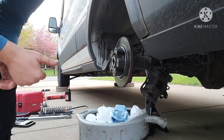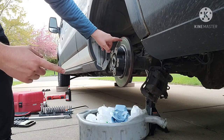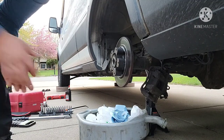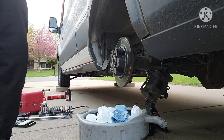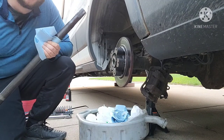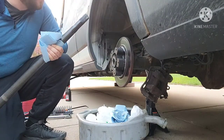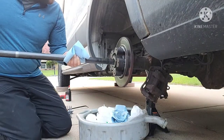All right, so the nuts are retorqued for the inside of the hub. Brake rotors on, cleaned up and anti-seized. Now we're gonna wipe off the shaft of the axle as we slide it in, and we'll throw the bolts in, torque it down. We're almost home free. All right, the only part you gotta worry about having this lubed up is the oil seal like we covered, and then the splines down here to make sure that when you go to slide it into your differential, it's not getting hung up on anything. Other than that, let's get her started.